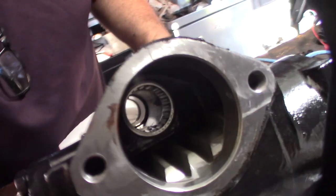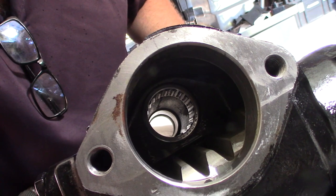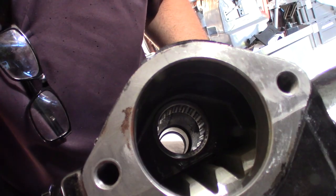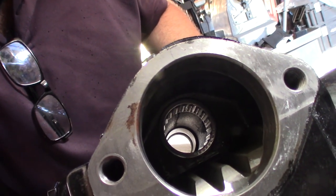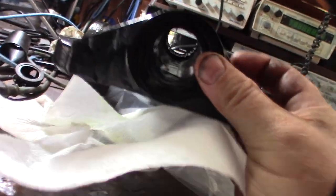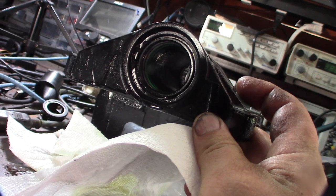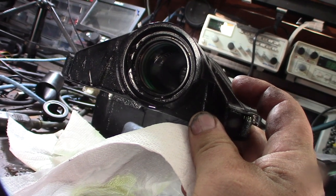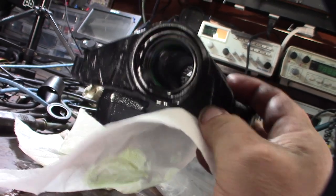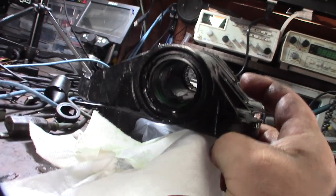For me to get, but see that there, it has some needle bearings on the top too, so that's actually an improvement. But the bottom part, which actually gets all the play and all the banging, there is no needle, it's just metal on metal, so that's not an improvement. That's where all the banging happens, so there needs to be a needle bearing down there.